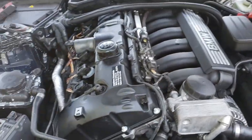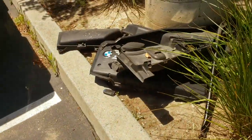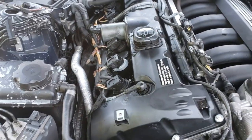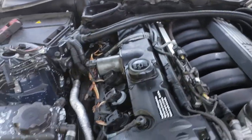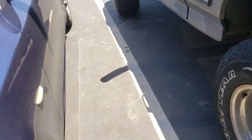Well, I'm finished here, except for those panel covers that go there. I have those over here, but we're ready to go key on, engine off at least 2 times to try to calibrate this one, at least to get the position, not calibrate. But going to do that and monitor fuel trim data.